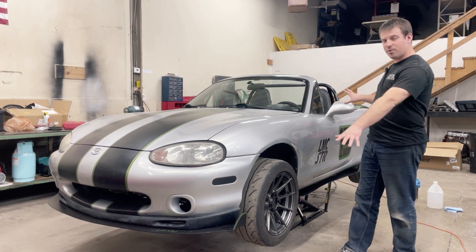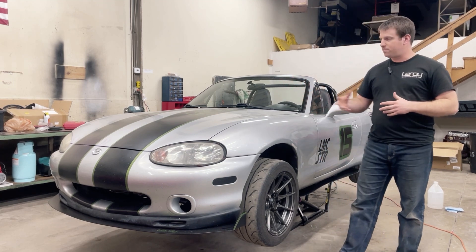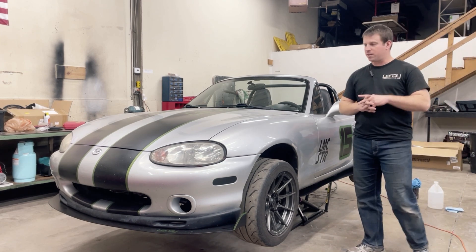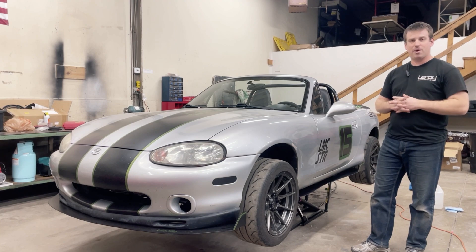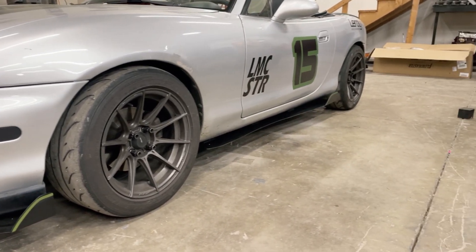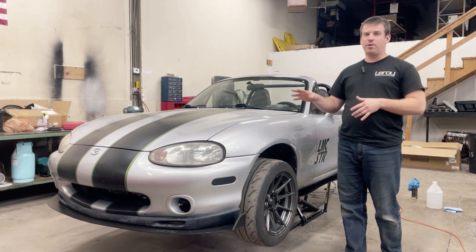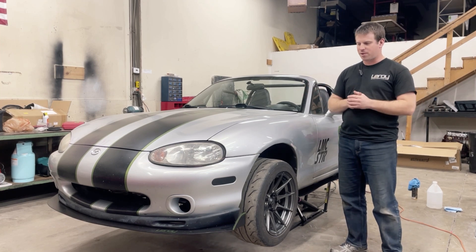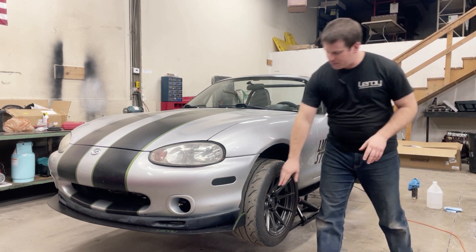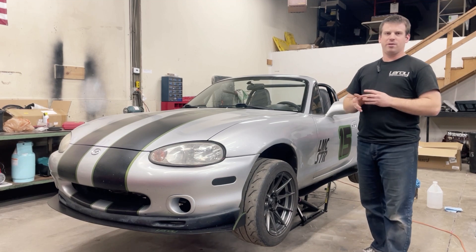This is in development — this is the first one. There are a couple of little things we still need to work out before we move to production and offer it for sale, but I want to throw it out there and get some feedback. We're making them out of 3003 aluminum, bent and then powder coated. Right now we're starting off with powder coating them black. If you wanted it in a custom color, we'll probably be able to offer that. The green stripes on here are all just vinyl, so you can do it up to match the rest of the livery on your car.